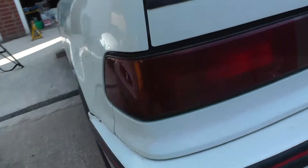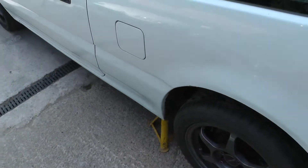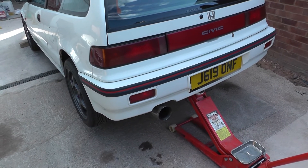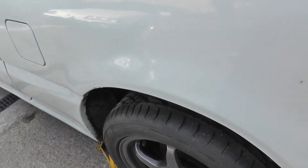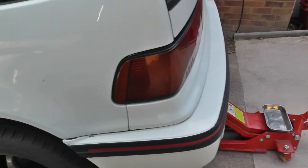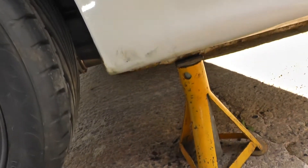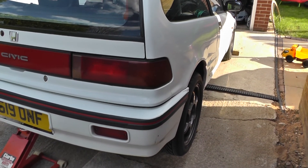All these bushes are a bit done. Another thing to point out is the wheel arches — at the back there's some rust, and on the other side there's a big bit missing. It's an old car. It's actually not as bad as I thought — these arches are a bit scary but I wonder if they could just be sanded right back. Some things here aren't very clever though, as this rust is coming from the inside, so in reality they'd probably end up getting fully cut out.